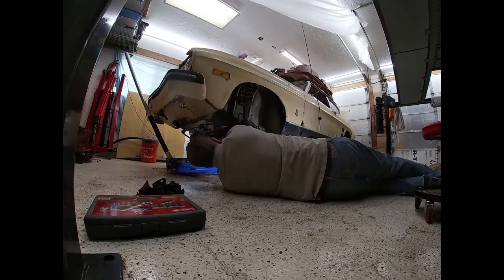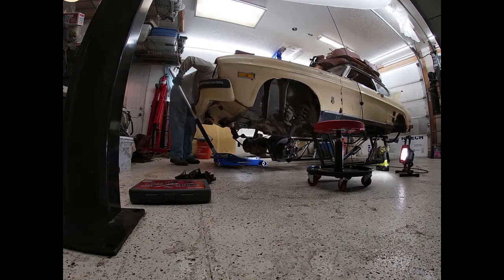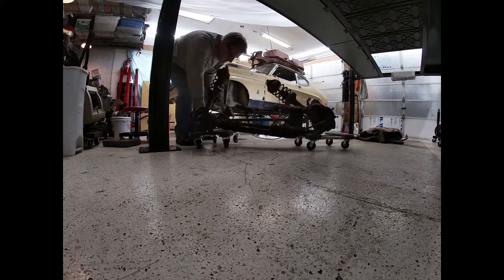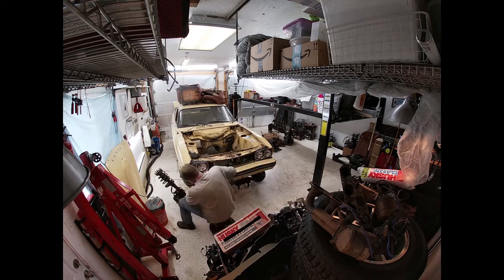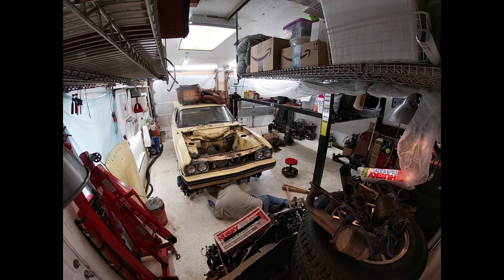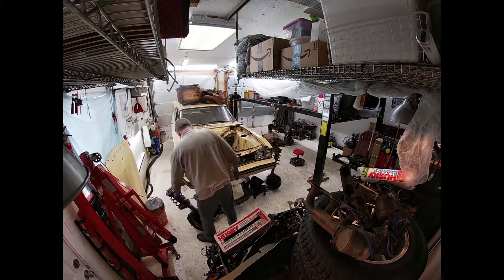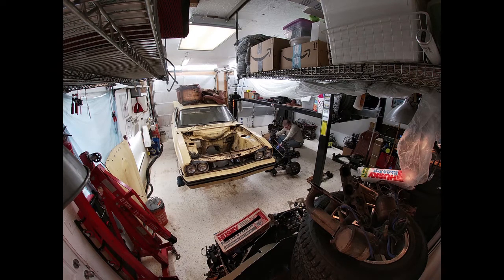Now we're going to take that front axle out because I would like to see if we can use the Mustang's. Again, the Mustang's got 5-lug wheels, much bigger brakes, disc brakes all the way around versus drums on the back. It's got an anti-lock brake system that we should be able to wire back up and have in the car, which could be useful. And the other thing about it is, if anything breaks on the original Capri stuff, where do you find even a wheel bearing or a tie rod end or strut or what have you for a 1974 Capri versus a 2005 Mustang. That's the first year. I think 2005 to 2014 is all kind of the same on the Mustang, which would make our lives a lot easier.